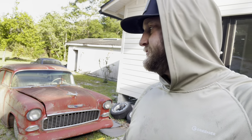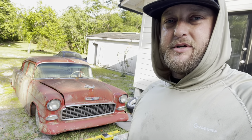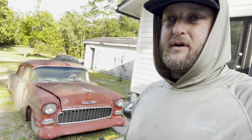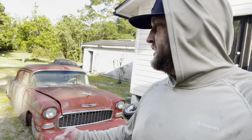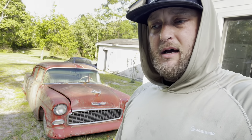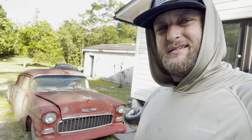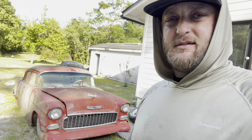So I'm gonna put that on, and I'm going to try to pump a little bit of air pressure into the tank, like hold my hand over it and hit it with some pressure to push some of that old gas out of the line, since it's disconnected up front. And then obviously that's going to go into an approved container.